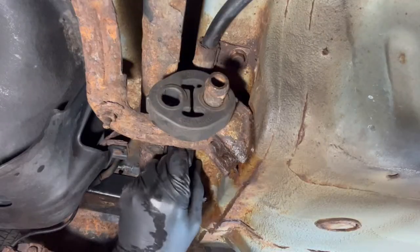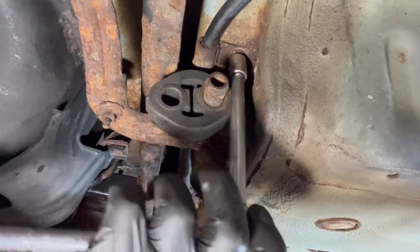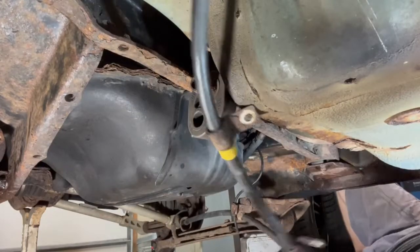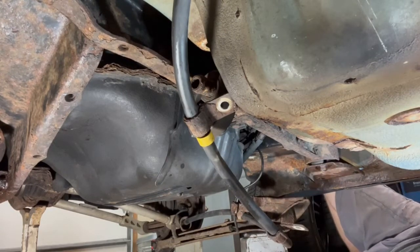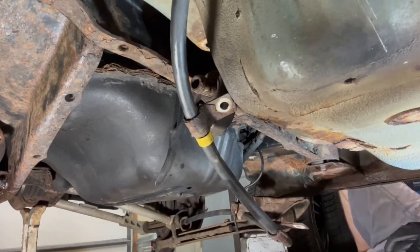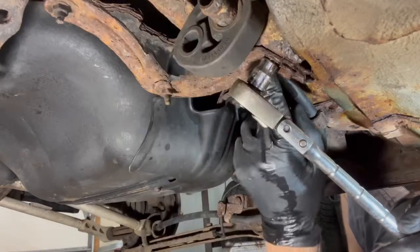That's going to be another fun one — I'm going to have to drill and easy-out that out of there. We've also got the emergency brake cable that we need to move out of the way so we can drop the t-bar bolts. These should come out no problem — got the bolts out of the cable, I can swing that cable out of the way. That should give me enough room to get this crossbar past. I'll do the same thing on the opposite side — two tie-downs just like that. I'm going to remove those and get this bracket out of the way; it wraps around the t-bar, so it needs to be out of the way to get the t-bar down.